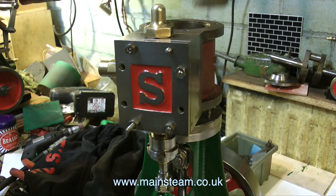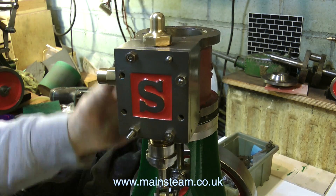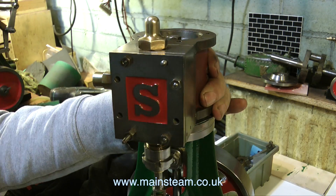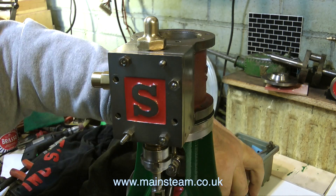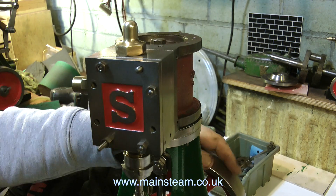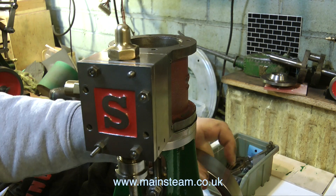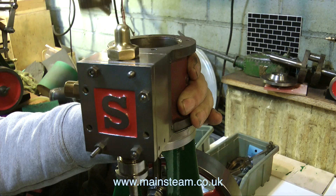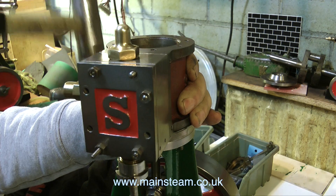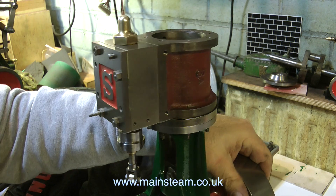As I mentioned previously, this engine is very well made, a little too well made in my opinion. I had to use a soft hammer to tap the cylinder down onto the piston. Of course, I carefully fitted the piston, compressing the rings before I put the piston into the cylinder, but then I still had to use this hammer. I've speeded it up so you can see what I'm doing — I'm going round in a circle, and eventually it sits level on the bottom cylinder cover. Running in real time, you will hear that the hammer blows are quite gentle; I'm just sort of bouncing the hammer off the cylinder. You have to have your wits about you for this, and don't hit any vulnerable parts of the cylinder.